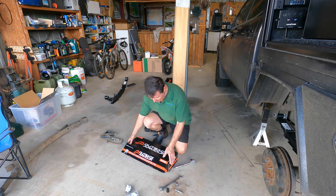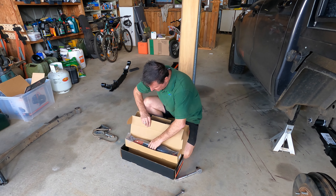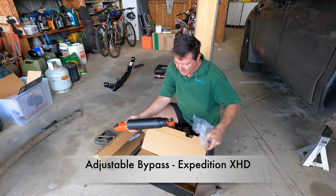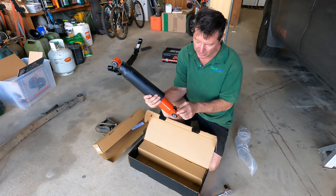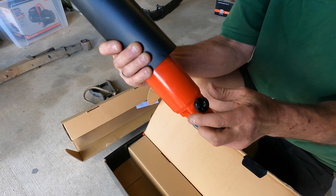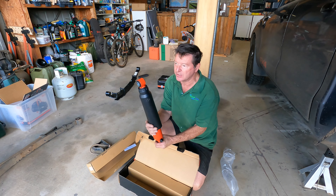Alright, another favourite bit — we're going to do the unboxing of the rear shocks. Check this out. We've got the adjustable here. They look quite nice, they've got some weight in them too. Nice and heavy. There's the adjustments there. They say they've got 20 adjustments, but I actually counted 30 clicks. So to start off I'm just going to put it at about 15 clicks when we put it in. I'll check that again later — nice and solid.